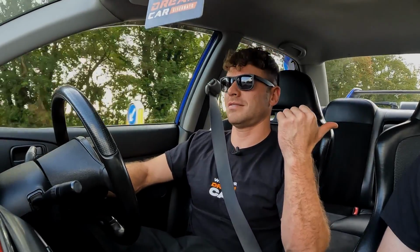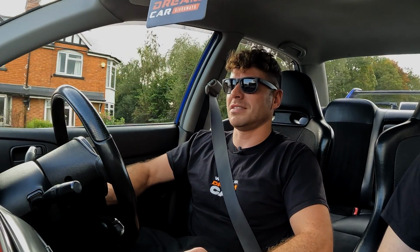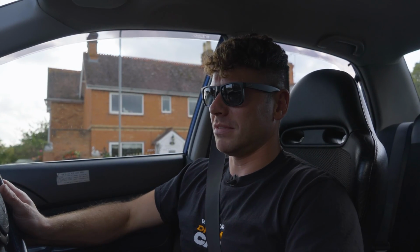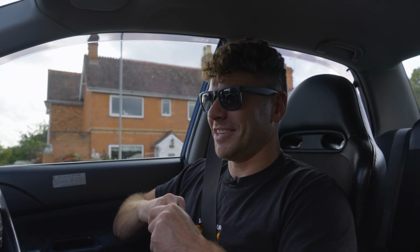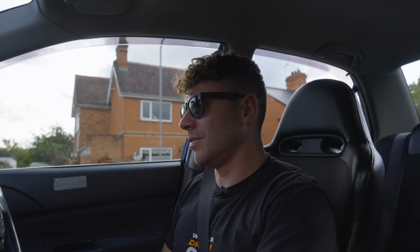I've done lots of those, rebuilding the pumps, even on low mileage examples, because of where they're situated on the car. On the 8s forward, they're on the near side rear, which is the worst possible place they could be on a UK driven car, because that's where all the dirt's going to be, on the near side closest to the hedge. And if your pump is totally knackered and can't be rebuilt, if that corrosion's got that bad and cracked things, you're looking at over £1,000. Not nice. So that's one thing to look out for when you're buying one.